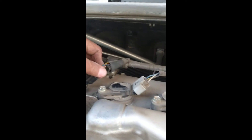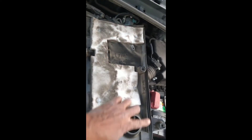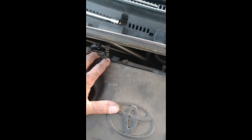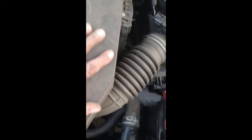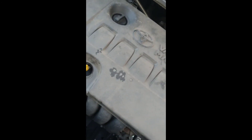Don't forget to plug in your coil wire — and that's basically it. That's how simple it is to replace this spark plug. You're going to need to buy a 14mm wrench for this. Just put the cover back on — you can see the strong pegs, there are four of them, and they hook up against these tabs. Align using the oil filler cap hole as a guide, press it in, jiggle it to make sure it's seated on the pegs, and you're done.